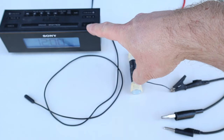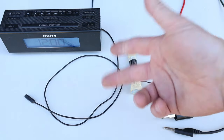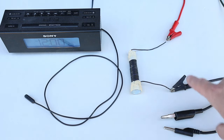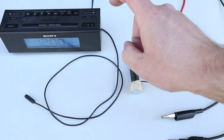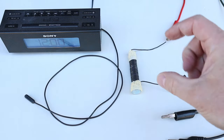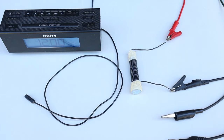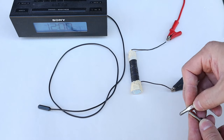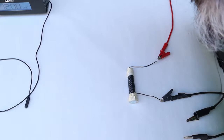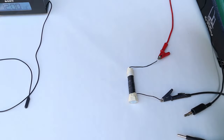I've got a radio tuned to the AM frequency and a coil of wire hooked up to a 12.7-volt power supply. When I make that connection, I'm sending 12.7 volts to the coil, and you'll hear clicking or static in the radio — that's electromagnetic interference. Even moving it nearly a foot away, we're still getting a massive amount of EMI. Now imagine that interference affecting all your sensors and other wires in your car.